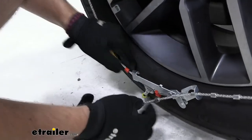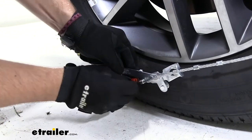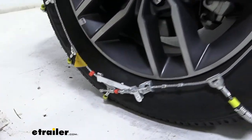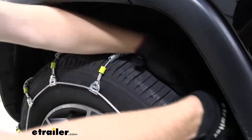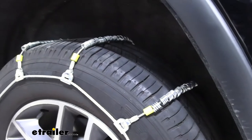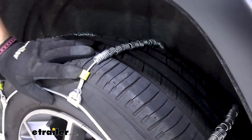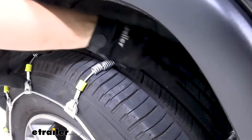You can also take our extra here and try to slot it into one of these plastic clips. Now that that's clamped, we won't have that extra bouncing around. Let's make sure we are set across our tire — things are looking nice and secure here without too much movement on our chains. I can get up to maybe my knuckle there, I think we do have a nice little fit. Since we are still utilizing these rollers, keep in mind that you are going to be just a little jagged — they should fit themselves in place as we drive.